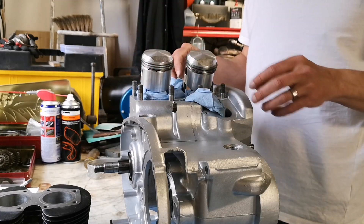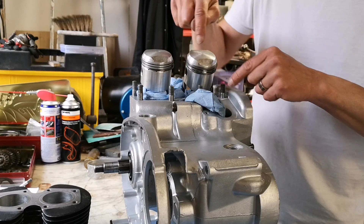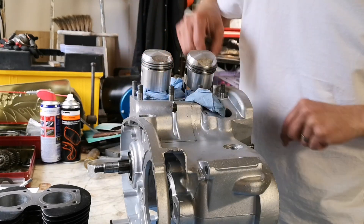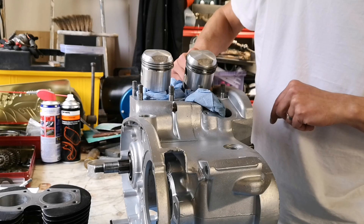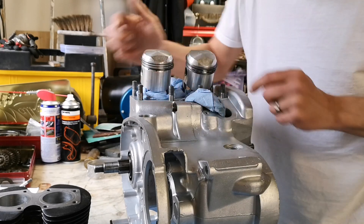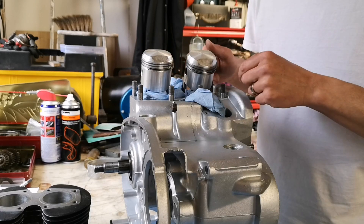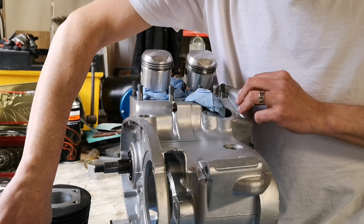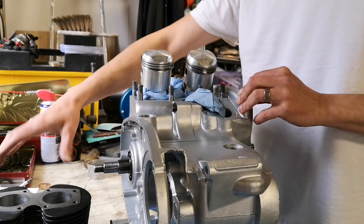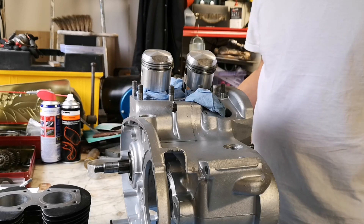I need to move the rings around. It's gasket time - I've put some gasket sealant around the bottom and I've got a couple of locating sleeves; I've got one on and need to put the other one on. I had to buy a new one because the old one went with the old barrels. Get some gasket sealant on, drop the cam followers in the barrels, zip tie those so they're held, get the gasket on, and we can put the barrels on.